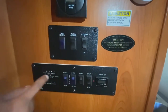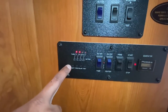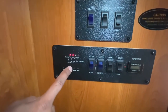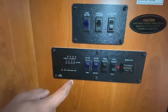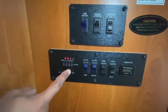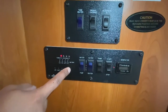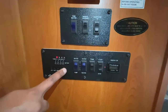The next are your measurements of what each thing holds. LPG is liquid petroleum gas — push that button and it tells you how much you have inside the tank. Battery — this is the battery for the rear of the RV. Fresh — this is for the fresh water, how much fresh water is in your tank, which is located below the bed. Black water — this is for your sewage water; it tells you how much of the tank has been used, so one third right now. Normally you want to get it when it's empty and return it when it's empty. Gray is for your sink water — your two sink drains go into a separate tank, and that will tell you how much is being used.